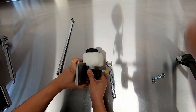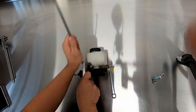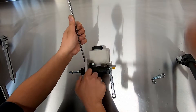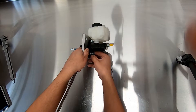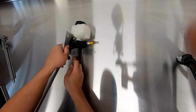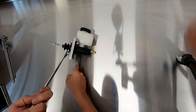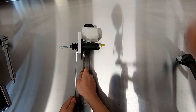You can fit your chosen master to the delete plate, or in my case make up a new plate with a revised master cylinder position. The master must be moved the same distance as the clevis pin so that the pushrod remains on a flat plane and you don't side-load the master cylinder pistons. This is as simple as drilling four mounting holes for the plate, two mounting holes for the master, and one large hole in the middle for the master cylinder to pass through the plate.